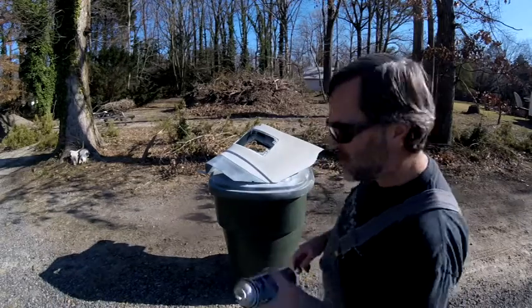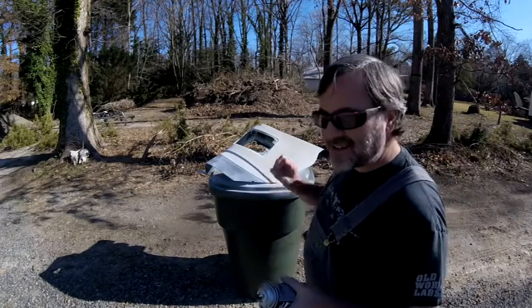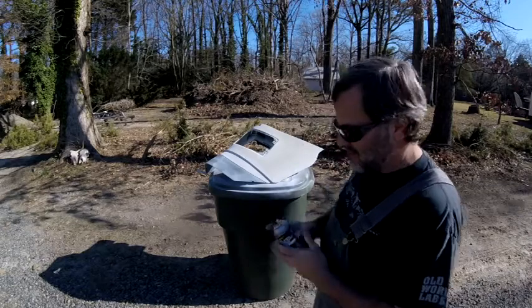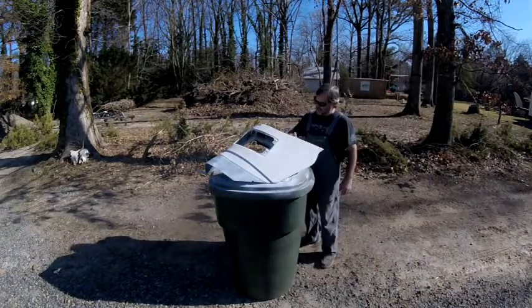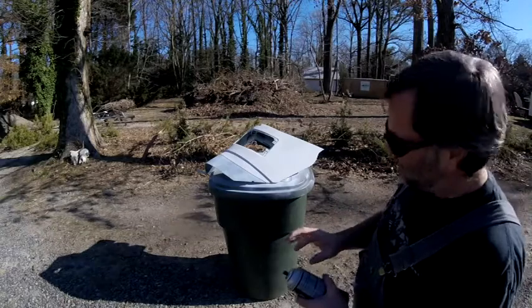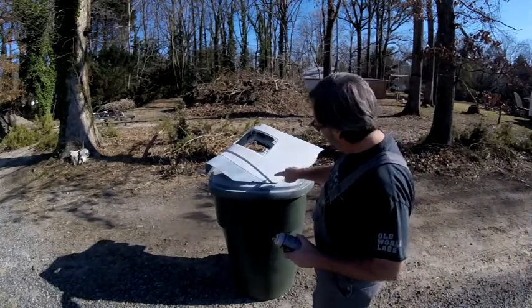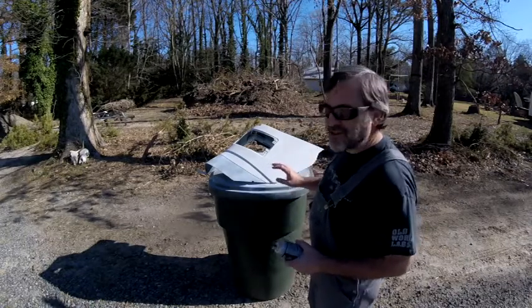Yeah, it isn't coming off. It's really good stuff. Plus the light dusting coats make it completely dry before you put the next coat on there. It makes it harder. It's looking like one uniform color. Now once I've put enough dust coats on there that I don't see any of these little marks around here, these little darker spots, I'll know that the coverage is good.